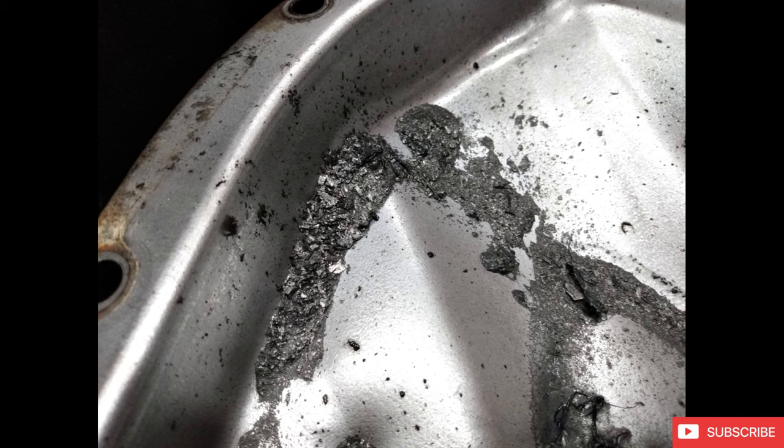Having done the stock ECU thing a couple times now in a few different builds, I've since gone to the Holley Terminator X on my latest build, my Jaguar XJ6 with the turbo LS. And with that being said, I probably will never go back to a stock ECU and HP Tuners if I can help it. It's just a lot easier interface, and even economically, you have to question the dollars and cents of Terminator X versus a stock ECU, right?